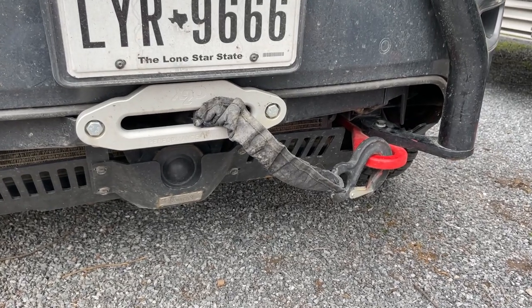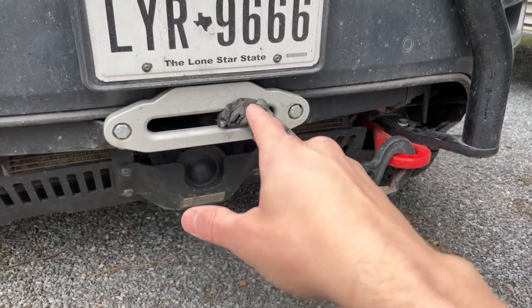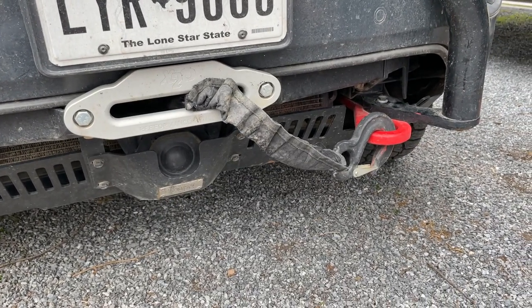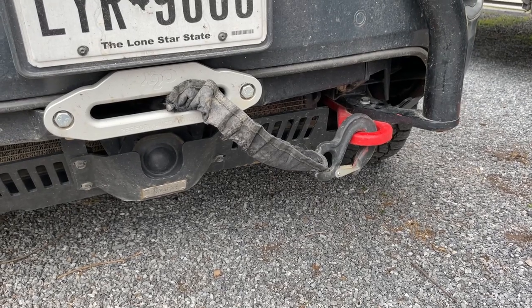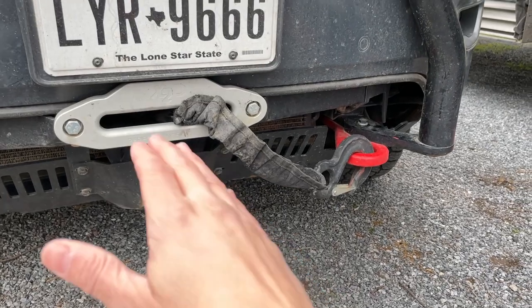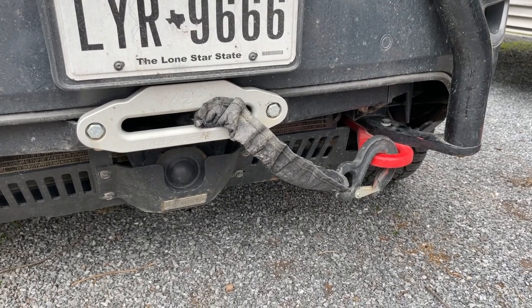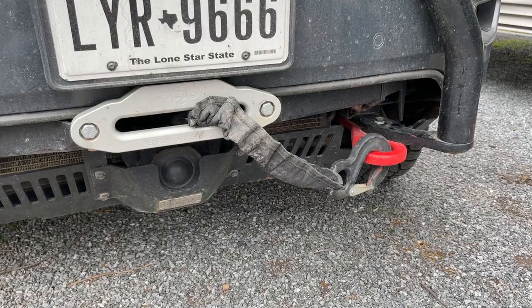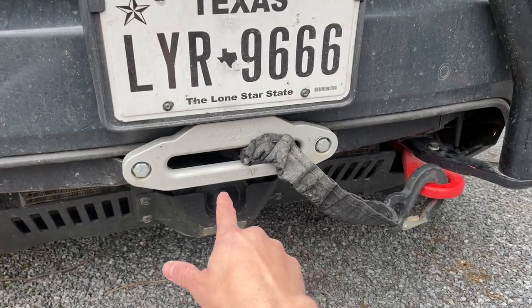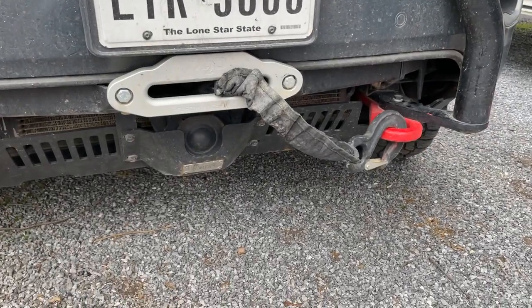One thing I haven't been real happy with is the protective cover that kind of comes along with it. It tends to bunch up in my fair lead and get caught up under there. My understanding is that synthetic rope has a tendency to be sensitive to UV light exposure, and over time if the rope is left out and exposed, it can really weaken your line. So what we're moving to is actually a thimble attachment that will get sucked all the way in and rest right on my fair lead, and then I can get rid of this and hopefully it won't have any more binding up happening.